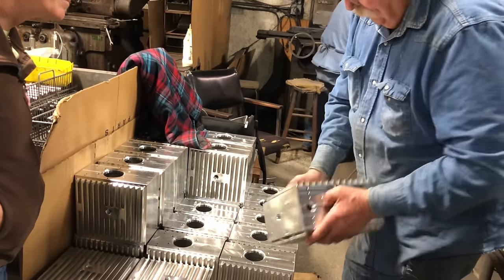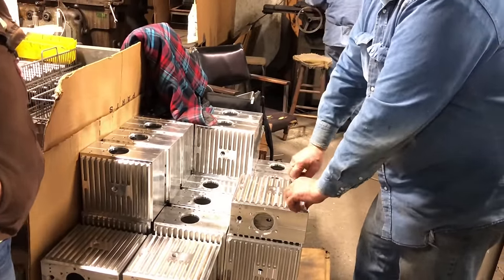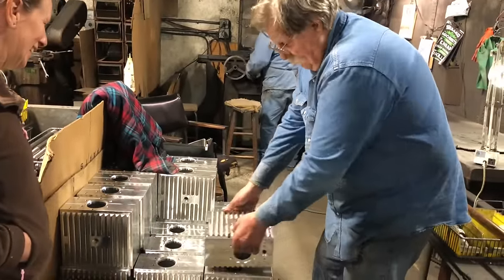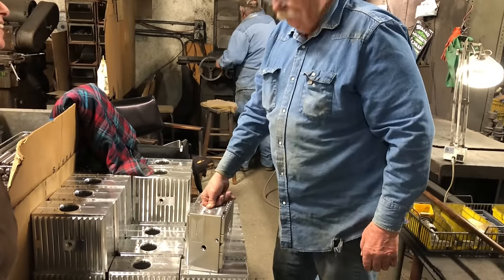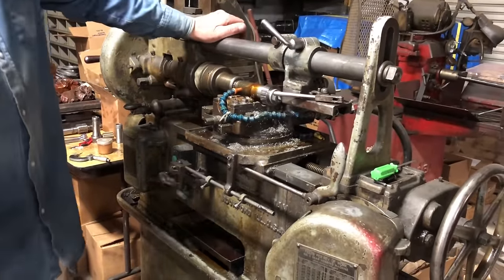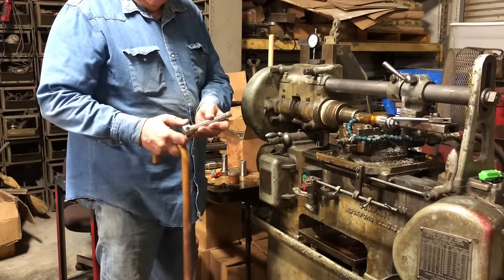The front has the shift rail location, and the rear gets machined, then everything gets deburred. What we call the blood test around here: you test it yourself — if you cut yourself on a burr you didn't do a good job. The little drilled and tapped holes require deburring on the back, and the big holes on both ends get finished. Then they go together — what a time saver. That spline is for the cluster. This setup lets you change the gears on the clusters so we can get different ratios. They even figured out how to spline these on the laser.